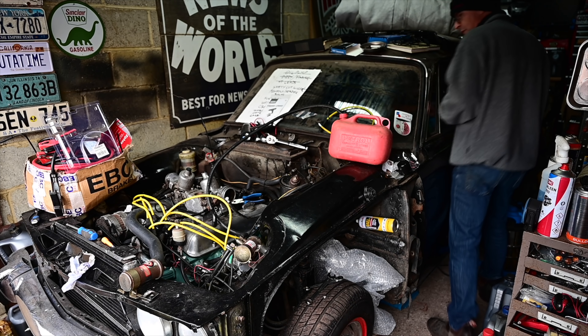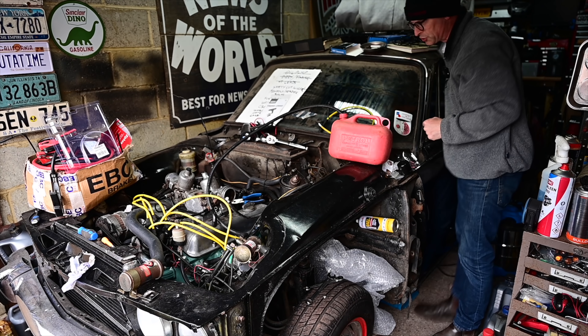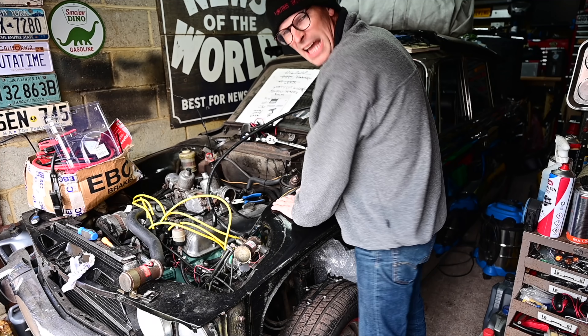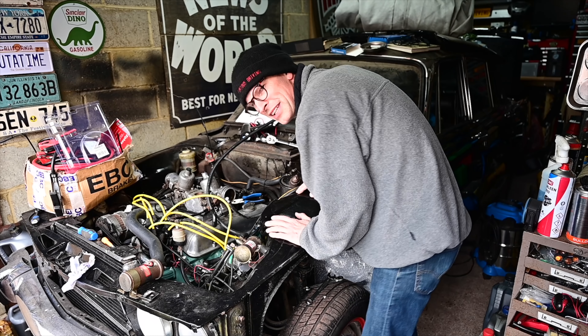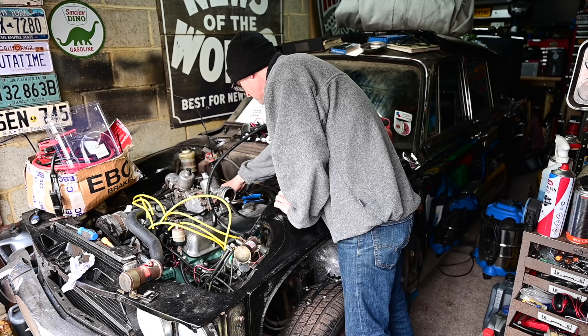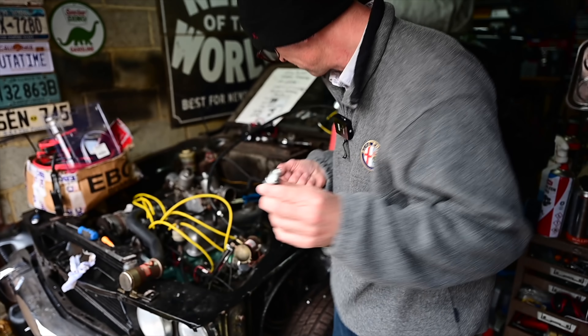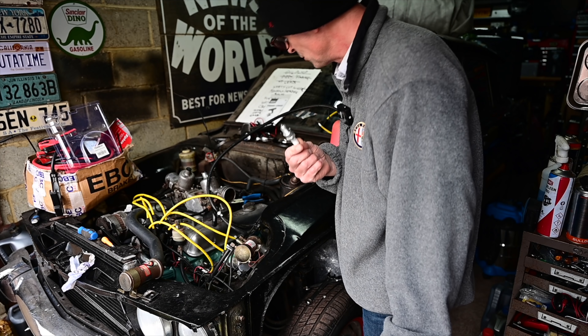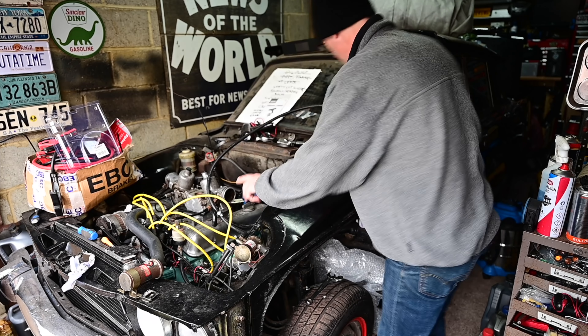Right, the last one - the last time before we give up on this for the day. Oh you stupid thing! Damn it. Oh you silly car, why won't you go? What's not connected? What is eluding me? Why won't you start? This is very very annoying. Well this is interesting - I've just pulled this plug out and it doesn't smell of petrol, but it does smell of easy start. Which is odd. Why would it not smell of petrol? I'm just going to give that a crank with no plug in there.